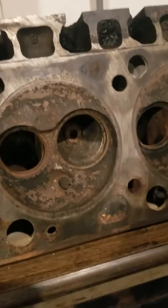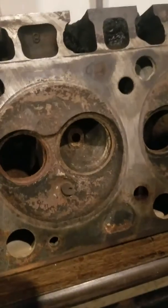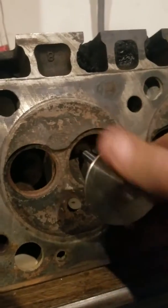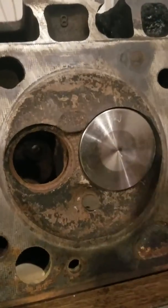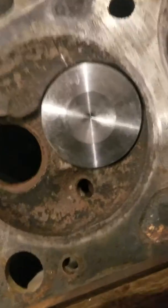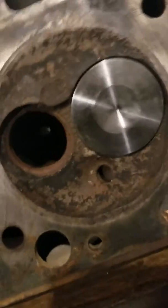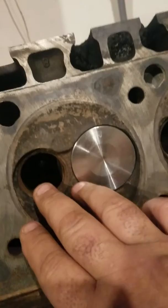These are the 950 heads off the 1970 El Dorado. They came with a stock 2-inch intake valve. I'm going to end up putting in a 2.25-inch — two and a quarter — and if you look, it comes just to the outside of everything on there. They're going to go to the machine shop in about a week as soon as I get the exhaust valves in. These were for a big block Chevy; I'm using a Pontiac 1.77 on the exhaust, so we'll see.